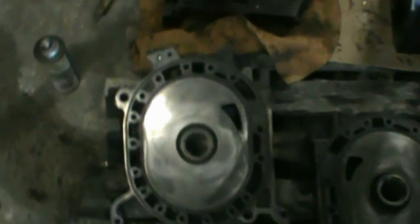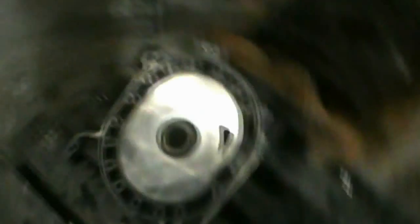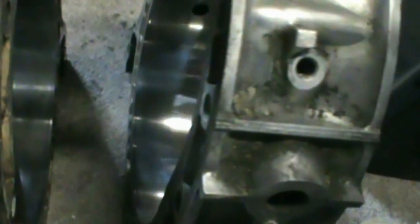I'm just getting started on the irons here. I went around and scraped out all the coolant seal and stuff out of the little slots. They're pretty much all ready to go — I just have to take out the stationary gears and then I can start soaking them in some parts cleaner. This is the center iron; it's not too bad, at least all the grooves are good. Yeah, so after these soak for a couple days I can start really cleaning them out, getting them down to bare metal on all three sides of the groove. Then I can start the porting. I have my housings over here — this replacement one from the parts car is not in 100% perfect shape but it's still a pretty good housing.